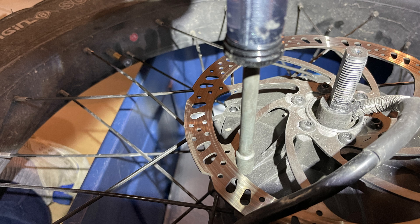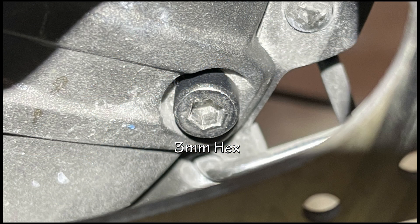I have the necessary bit in a long-shafted screwdriver that is thin enough to reach past the brake disc, but of course use whatever you have. Several videos mentioned these were security bits, but mine are a three millimeter hex bit.